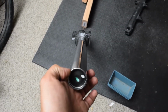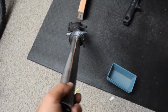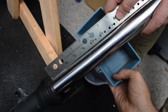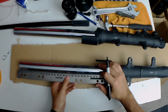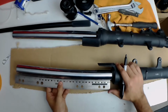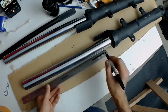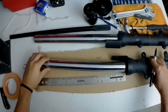You can see the bend in this thing. Looks like it bent right after the lower bracket. So if I push on it, I get full shock travel. Yeah, 100 thou. All right, we're in America here, 2 or 3 millimeters. There's one flat spot there, so ideally if I spin this 180, there should be the other straight spot on the other side. Yeah, there it is. So if I check, those are like exactly 180 to each other.